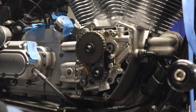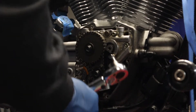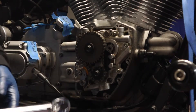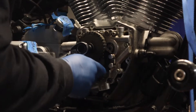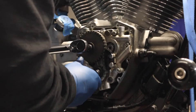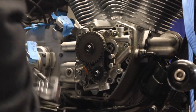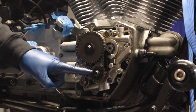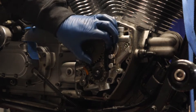First step is 15 foot-pounds on both. Then the top bolt goes to 34 foot-pounds and the other goes to 24 foot-pounds. I don't have the proper tool so I'm going to use a step tool I had from my chain install — wedged in here — it worked last time. Final torque: 34 and 24. Threadlocker on the rear cam sprocket bolt, no threadlocker on the crank bolt. Timing marks are still good.